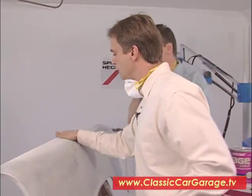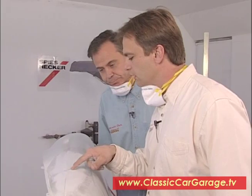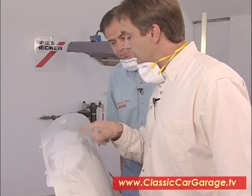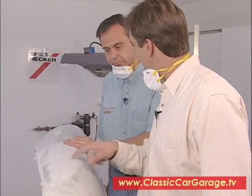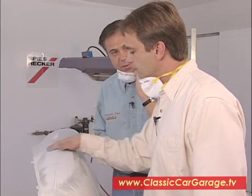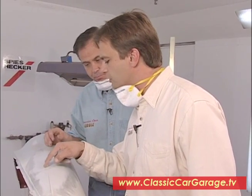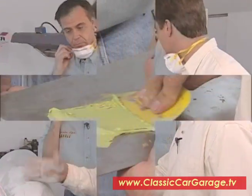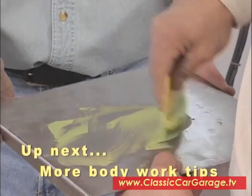After sanding, we can see what this tells us about the fender. We can see a little bit right there — that's where the weld was, where we had to weld a little hole up. We've got just a little bit of a low spot there, not real bad. You can see how strong this primer is — we only put two coats on here, and look at the filling capabilities. That's pretty clean. If the whole rest of the fender turns out this way, we really don't have much work to do. We'll take a little Scotch-Brite and remove any guide coat before putting any plastic over the top of that.